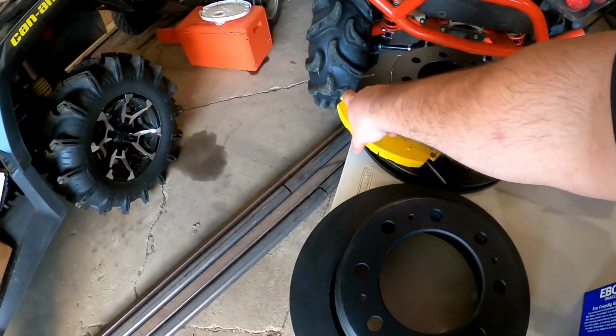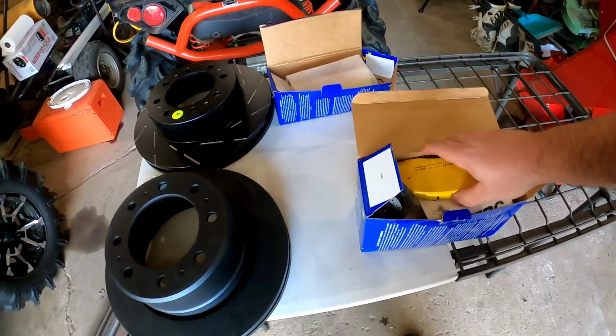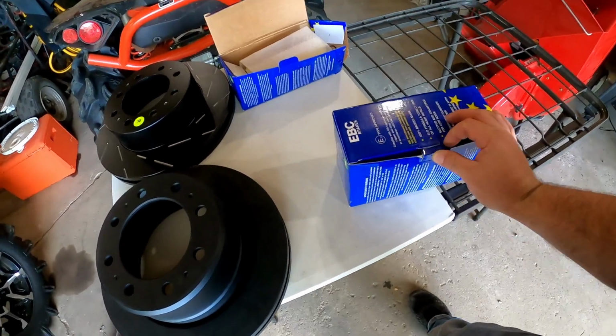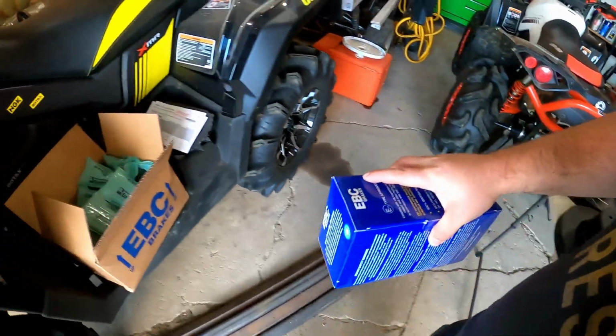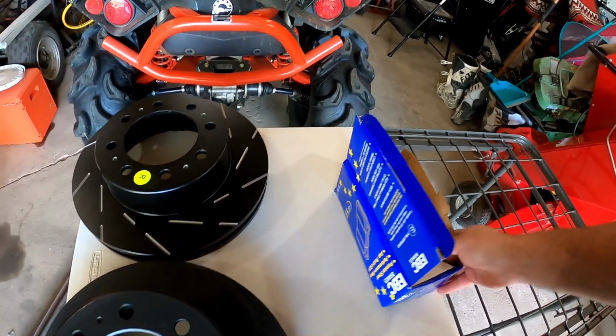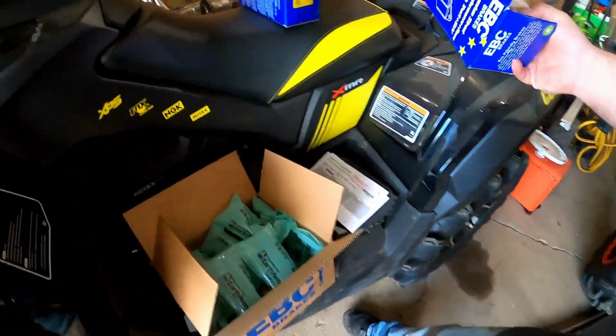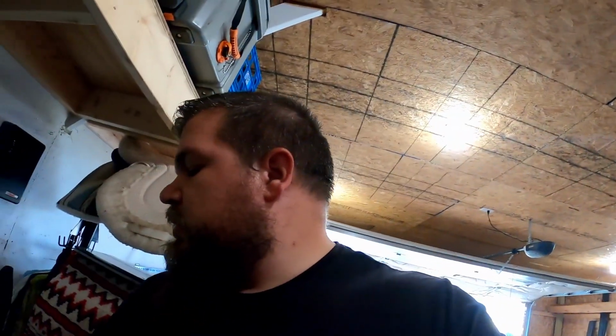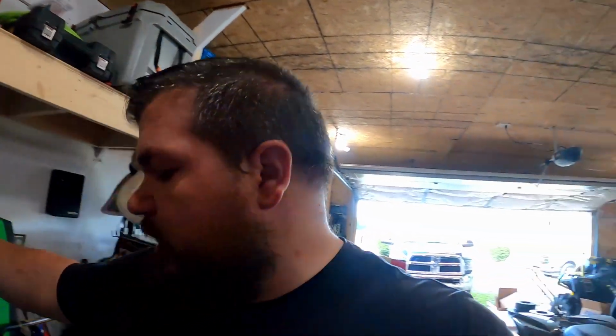The OEM brake caliper on, I believe it's my driver's side, it drags. And it has dragged for quite a while. We've got two vehicles, and the truck sits the majority of the time because, well, it's just cheaper to drive my wife's car. So I've never really sweat the fact that the caliper kind of drags a little bit. It's not bad. It gets a little warm after going on long trips, and you can definitely tell that it's hotter than the rest of the calipers. And so I went ahead and got new calipers automatically, assuming that it's an issue with the caliper. It can just be an issue with a pad hanging up. It doesn't necessarily have to be a caliper if you got a sticky brake pad or something along those lines.